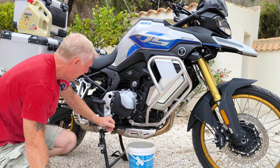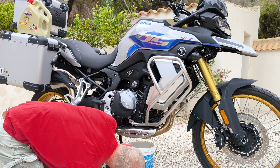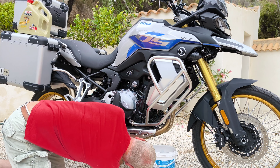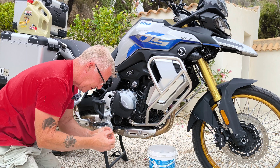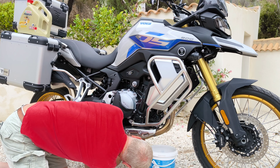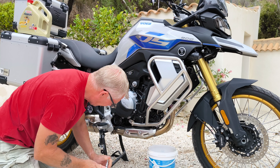I'll go get the plug and put it back in and give it a good clean. I want to check — I didn't see a copper washer on the plug. Let's look under the bike — ah yes, the washer is stuck to the bike. I'm going to reuse the washer; I know it's ideal to replace it, but it's an aluminium washer, it doesn't look overly compressed, and it's only been in there for 500km. Good job I spotted that — it may have dropped in the oil and we'd have had a few drips. We'll go back in with that.